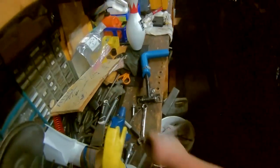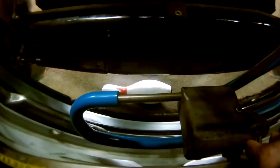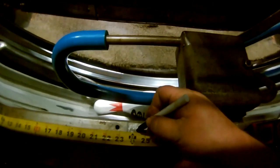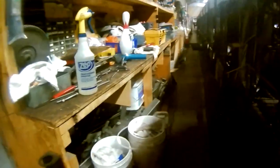Now again, it's not sitting there. The lift rods have been adjusted. We have yet to see a ball stop and spin on the ball wheel. Woo, that's dirty. Alright, so now we got a clean surface. Let's try this again. We'll grab our marker. Come over 24 and a quarter inch. Hey, you can see that line. You can see that much better.